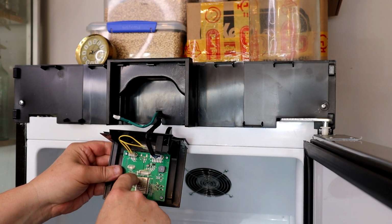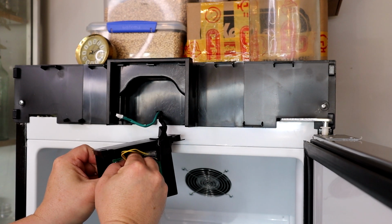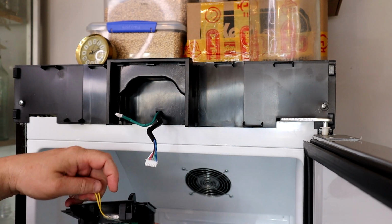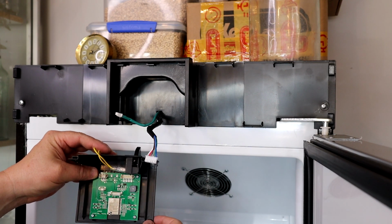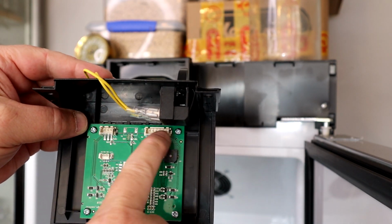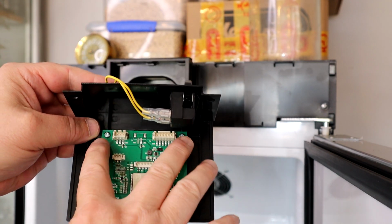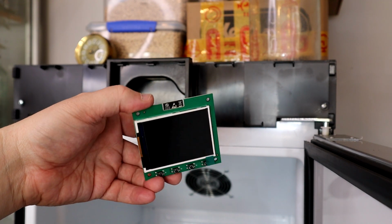It was sitting there. So it really is as simple as taking these plugs out. As usual with most of these electronics, only one plug will fit in the one hole, you know what I mean? You're not going to get them in the wrong hole. See, it was sitting up here, and that was a 2 hole, that's a 3 hole, and that's a 6 hole. You can't mess them up putting them back in the wrong spot. So I'll just undo these 4 screws and put the new screen in.